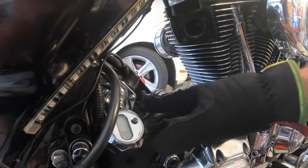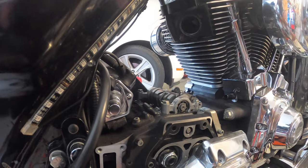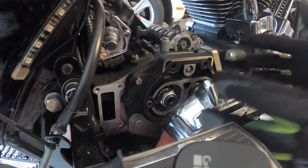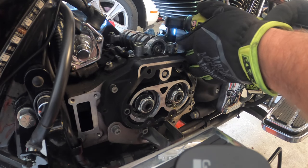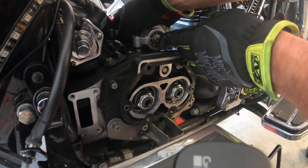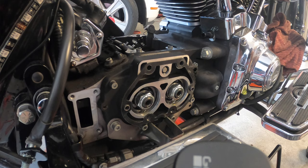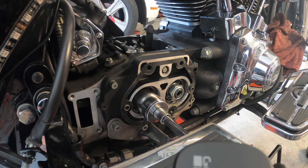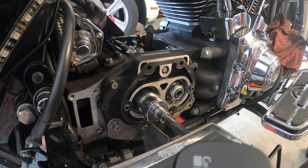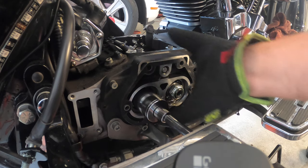I've decided I need to remove the oil filler area as well to access both the speed sensor and the transmission. With that area cleared, I now have full access to the transmission. I'm removing the top cover bolts in a crisscross pattern. Lifting the top cover very slowly to make sure all four dowels remain seated in their holes — otherwise they could drop into the gearbox. I then put the gearbox into two gears simultaneously so it locks up and won't turn, which allows me to remove the main shaft bolt and pull the sleeve off so I can extract the gearbox.